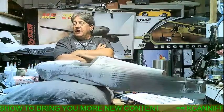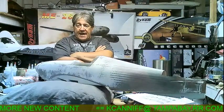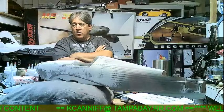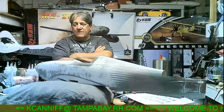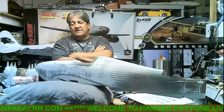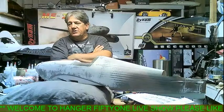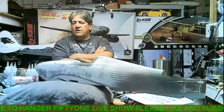You know, Ken, I really don't know. If you've got an extra ESC around, I would try that. Just pop that one out, pop another one in, and see if the problem continues. And if it does, then I would say it's got to be the receiver. Are you running 2 satellite receivers in your RV8?